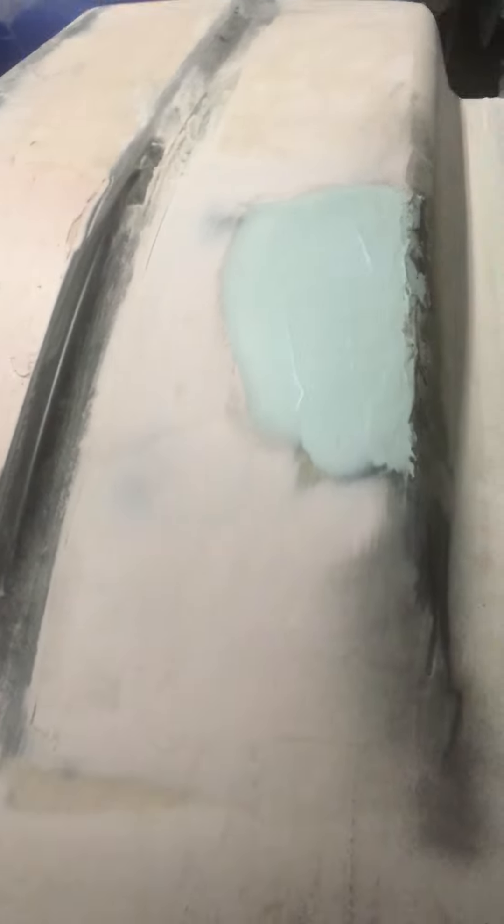So you can get different coloured hardeners for your filler. If you're buying filler, see if you can get a blue hardener as opposed to the brown hardener that often comes with it, or there are even yellow hardeners. The other thing you can do is put a tint in with the body filler, and that will change its colour too.